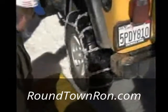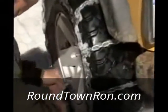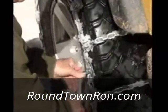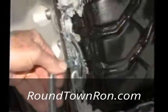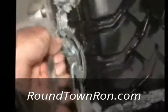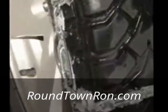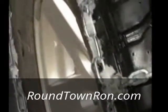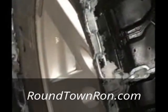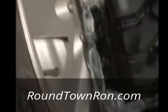The camming, which basically will tighten the chain up even more so that you eliminate the necessity for the rubber adjusters. You put the camming wrench into this area here, and what you want to do is give the cam a 180-degree rotation, like so. And what that does is that locks the cams into position and eliminates our need for tensioners.